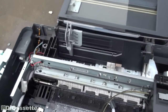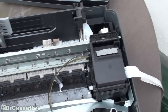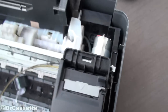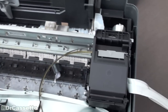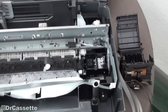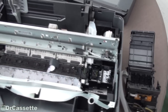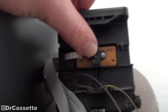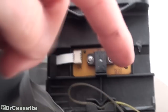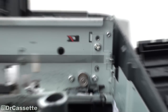There are a bunch of gears in here, but all cheap plastic. I don't think I'll be able to get any interesting mechanical parts out of here, except for that motor maybe — that actually seems to be a pretty powerful motor right there. I guess this thing manages to work with just one motor. I took out the assembly that holds the ink cartridges. Here is something interesting — this is how the printer tells where this assembly is, what position it has. We have a little optical pickup sensor right there. Through that groove down there slides this band — goes all the way across. This actually has little fine lines printed on it — vertical lines, all just a fraction of a millimeter wide. That's how this thing tells where the assembly is on the track. Pretty interesting.